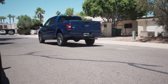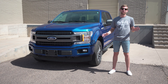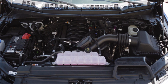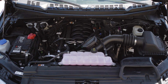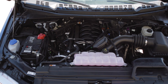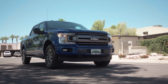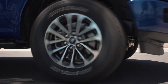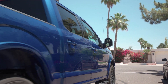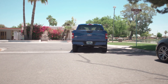As exciting as the lightning blue paint and the brand new 2018 redesigned truck are, the main thing we're really excited about is what's under the hood. This is a 5.0, which for 2018 has been amped up a little bit — they added direct fuel injection for a bit more power, and the biggest change is the new 10-speed automatic transmission paired with it. We tried the 10-speed on one of our EcoBoost trucks — our 2017 had it — and we were really surprised with how good that transmission was and how well it applied power. So we're super excited to run it with the 5.0.